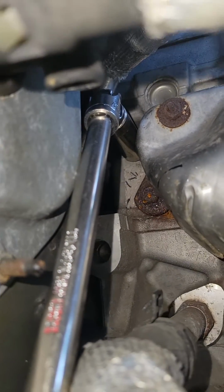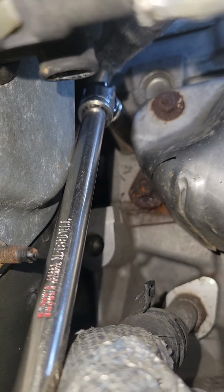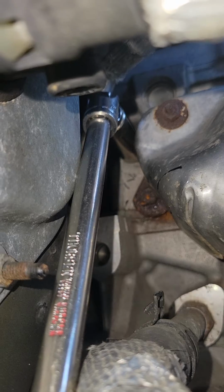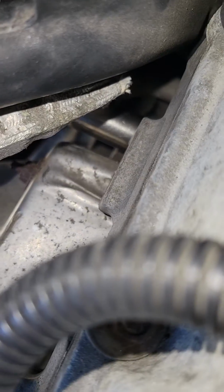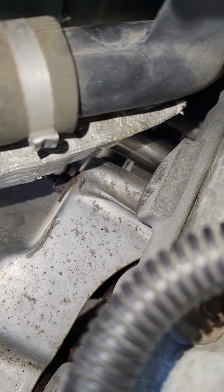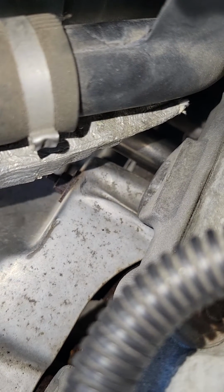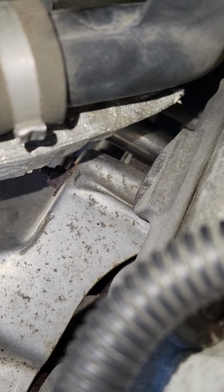That's all I do. And just put a ratchet on the end of the driver and you can turn it out, okay? That's one way of doing it, guys. You could also come up here with your socket and simply put your socket over the coolant temperature sensor and your ratchet will go over the socket. There's more than enough room up here to do it and turn it out as well. So now you have options as to how you can do it, and I'll leave it up to you as to which route you take.